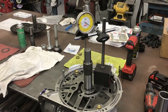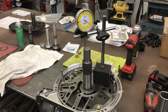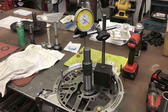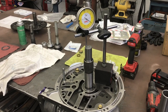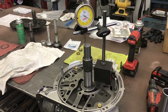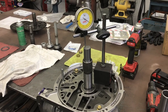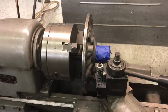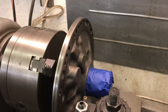This is my mock-up. The back half of the pump attached with a couple bolts provides an excellent flat spot for the magnet to attach for the dial indicator. To check end play I steady the case with one arm and push up and down on the output shaft — that's a direct reading on the input shaft because they touch in the middle. I set the dial indicator up and cut 30 thousandths off the surface on the back of the pump.